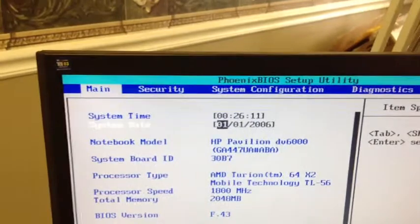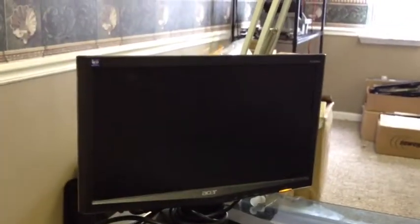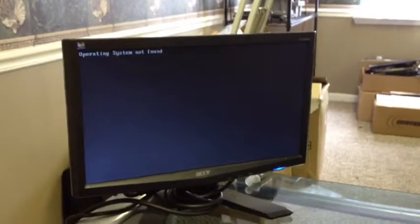The system is actually working and everything looks good, but we could unplug the CMOS battery and turn it back on and we would get a reset. Let's see if I'm right — I could be completely wrong, but I'm pretty sure I may end up being right on this one. And we got an 'operating system not found' just because we didn't get into CMOS quickly enough.